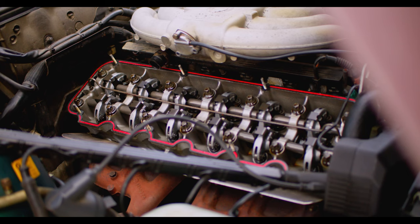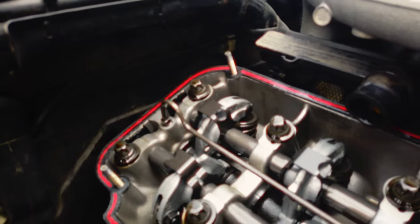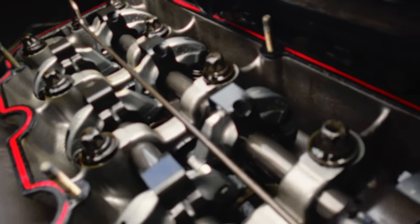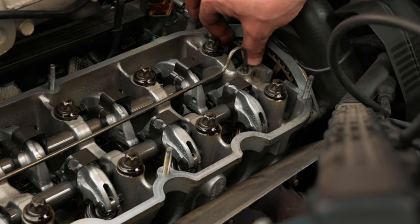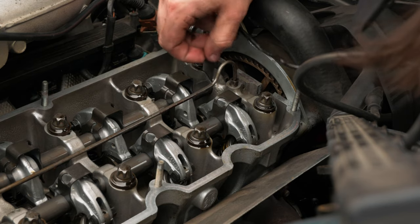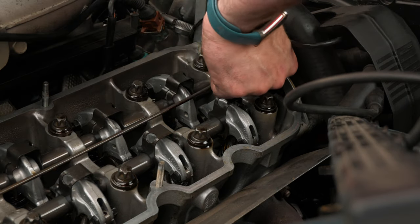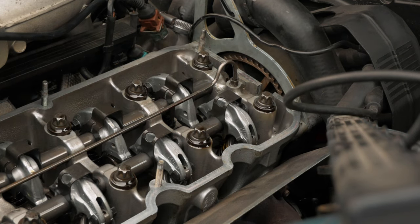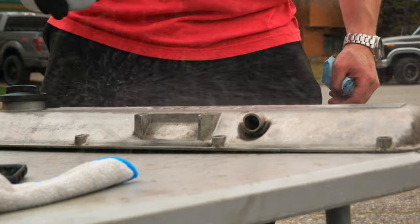Well, that wasn't what I was expecting, but in a very, very good way. Everything in here is basically brand new, which is exceptionally cool. What's not as cool is the amount of leftover silicone everywhere where the valve cover is supposed to seat. RTV gasket maker is nice, but you need to use it sparingly. If you use too much, it tends to create an uneven surface, which causes it to leak — and that's what I believe happened here. There's a layer going across pretty much the entire head of the engine, and it was practically gluing the two half-moon gaskets on either side. Once they were out, I spent a long time using a razor blade to clean up the entire gasket surface so it's actually going to seal.